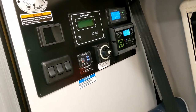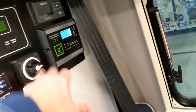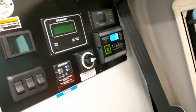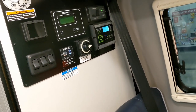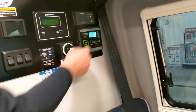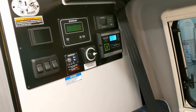What I'd do is plug it in, leave the solar on, and leave the main switch on. You never turn off the solar. The inverter switch I'd just shut off when you're sitting at home not running the AC. There's a label saying 'solar off when batteries off' — when the battery switch is off, turn that off too, otherwise it's just a parasitic power draw. When driving, leave all these on so the second alternator charges the batteries along with the solar.